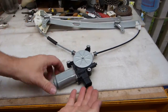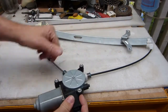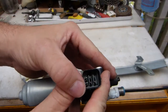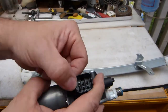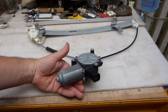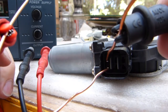When this motor is powered or 12 volts is supplied to its connector, it just doesn't run and doesn't raise and lower the window. It is normally connected in both configurations — one is ground, the other is power, and it really doesn't matter which is which. It must run both ways. Nothing. Absolutely nothing.